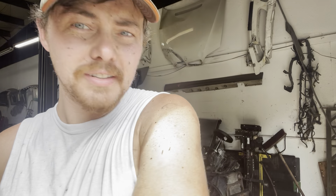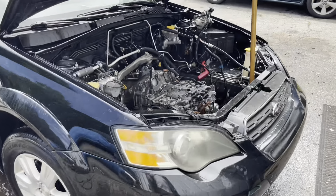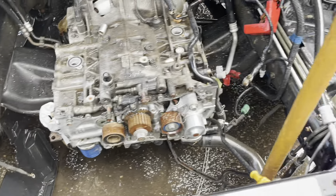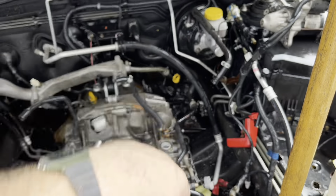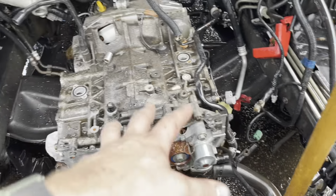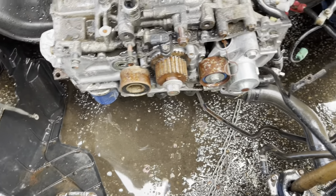I got peppered all over the place — they had a little pocket in there with a bunch of gunk, and I'm wearing most of it now. But I didn't do the back or anything; I was more focused on just the gunk up here and all the stuff in all the crevices. So here we go. All washed up, everything's cleaned out. I'm gonna prime the fuel lines and stuff to blow all the water that may have gotten in. I did plug the exhaust — I didn't want to fill the converters up with water; that's a good way to rust the exhaust out quick.